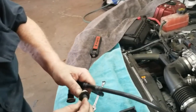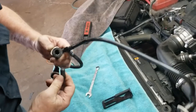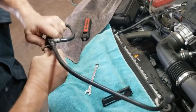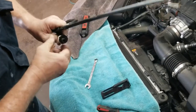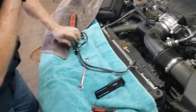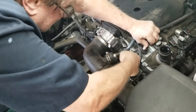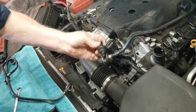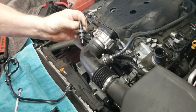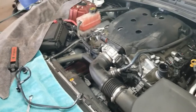We're going to be putting this back on, so we're going to push the release in. You're going to lubricate this a little and stick it in there so that it is going to stay. We're going to pry these out. These are a one-way valve that we're going to be drilling out so that the air can flow between both of the valve covers.